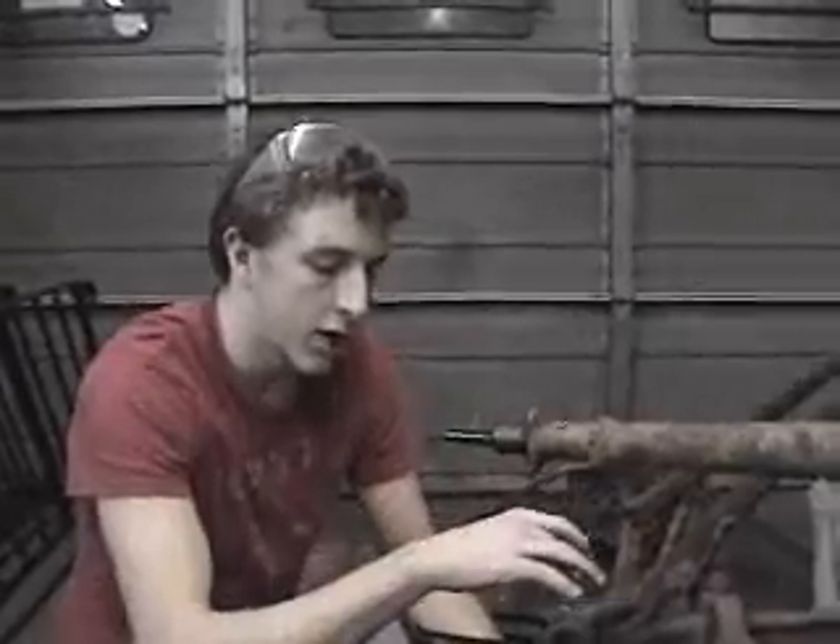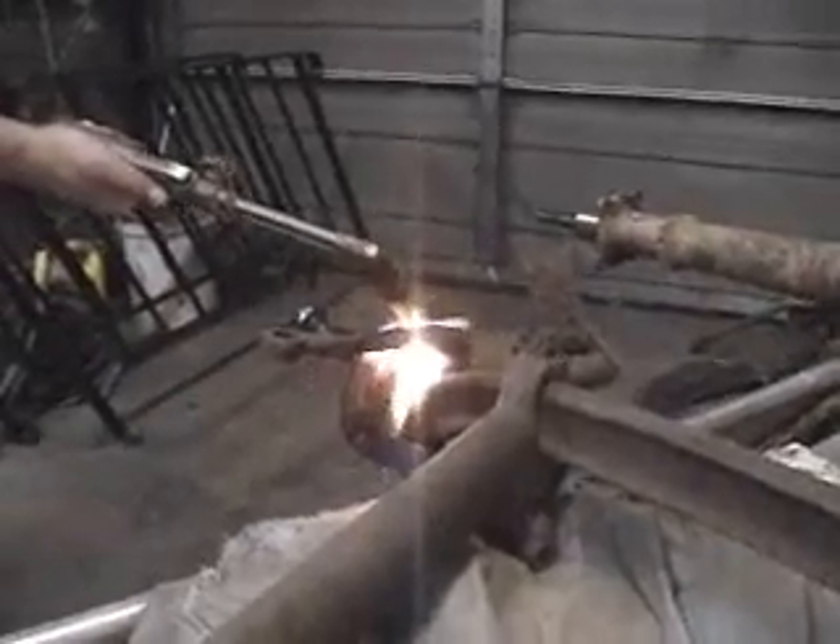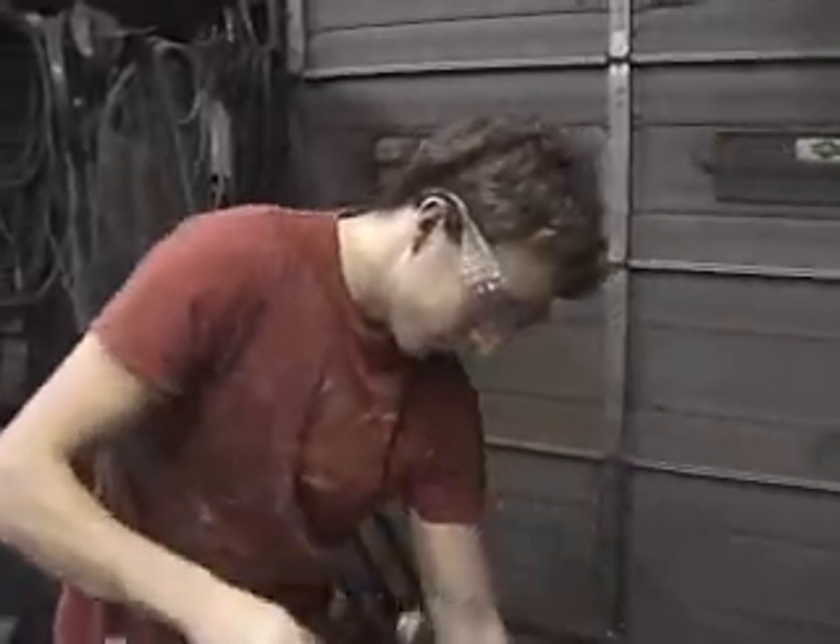We're probably going to try to put it in the press and try to press that out. What we're doing now is heating all the metal around the kingpin, because when metal's heated, it expands and gets bigger. We're hoping that once we heat it up hot enough, we'll just be able to beat it and knock it out. But if this doesn't work, we'll have to go use the press to push this out. It looks like we'll probably have to press this out.